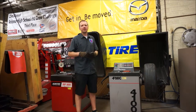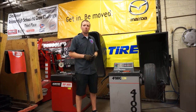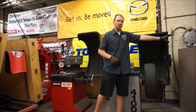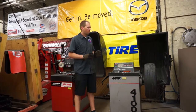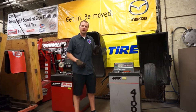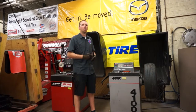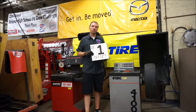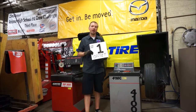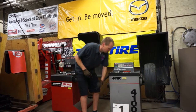When you're doing a set of tires, if all the wheel and tires are the same, you just have to put these measurements in once. Every time you switch to a different offset wheel and tire, a different width, or a different diameter, you need to put these measurements in again. There are three measurements you have to enter and get correct, otherwise the machine can't give you the right information. The first measurement the tire machine needs is the offset of the wheel and tire to the machine itself, so it can figure out how far away the tire is depending on the wheel's offset.